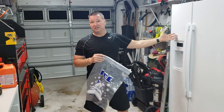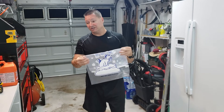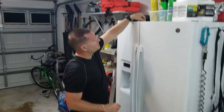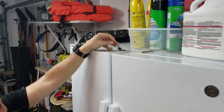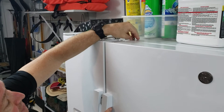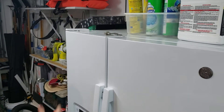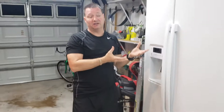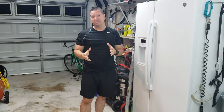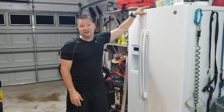When you have enough ice, you'll obviously just shut the machine off, because it'll produce ice until you do. I went a step further and put a little lock on this one. The last one I had out here produced so much ice I forgot to shut it off, and what it'll do is keep your door open. If you forget to shut it off, it's going to keep producing ice, and sometimes when there's too much in there it will pop your door open. So that's just a little safety feature so you don't ruin your refrigerator.